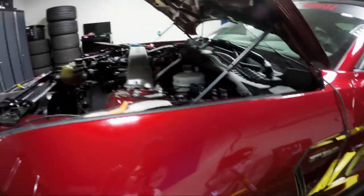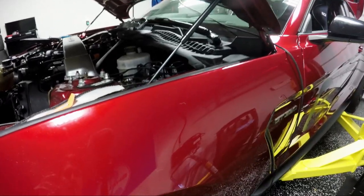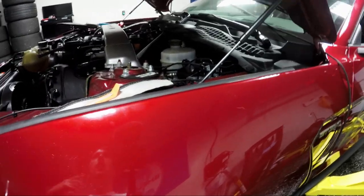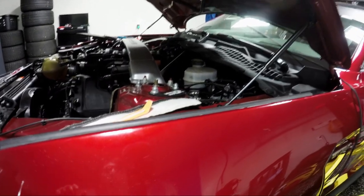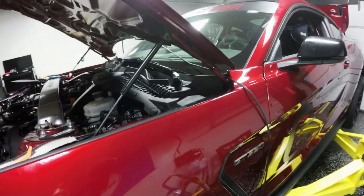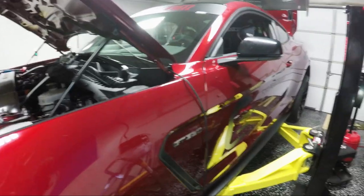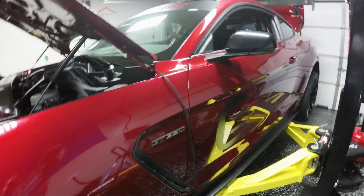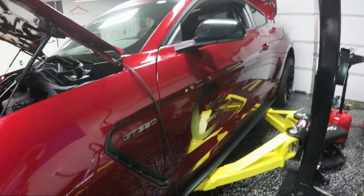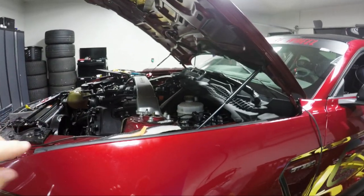One of the other things that happened is when I got home from Circuit of the Americas, I rushed out of town and forgot to put the charger on the battery. Something in the system — probably SYNC 3 and some of that other stuff — draws amperage. So part of what we're going to do is pull all the fuses to completely disconnect that, and we're also going to be installing a battery kill switch. I have a little solenoid coming in tomorrow and we're going to wire up a kill switch.